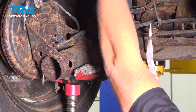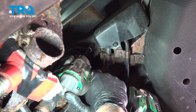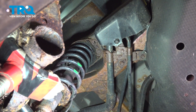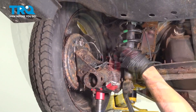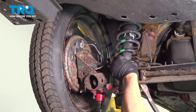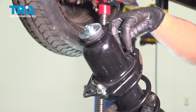I'll get another bolt up here. Using a 14-millimeter socket, take this bolt out. Slide that out, just lower the floor jack a little bit. Slide that off and it comes right out. You want to take these nuts off — we're going to use those up top.